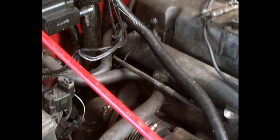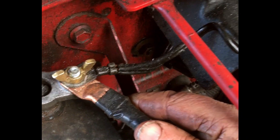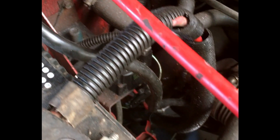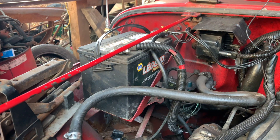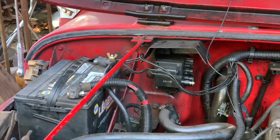Something else we had to do here — I could not get this thing to crank over. It would barely crank over. So what I had to do, like the big diesel trucks, I went from the ground right down to the starter. The bigger battery definitely seems like a must with the added electrical components like glow plugs, and it's certainly going to be necessary on these cold winter days just to crank the diesel over.